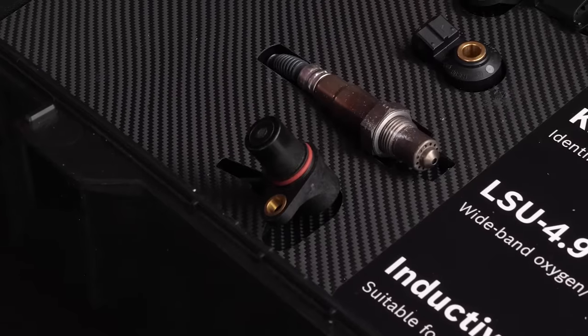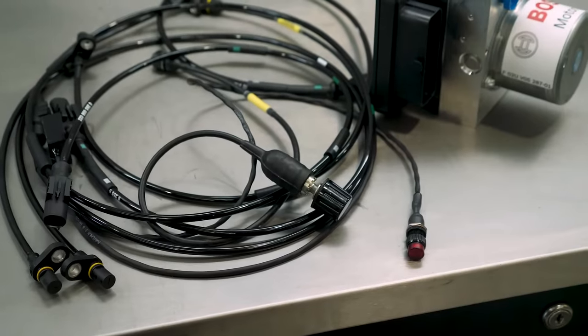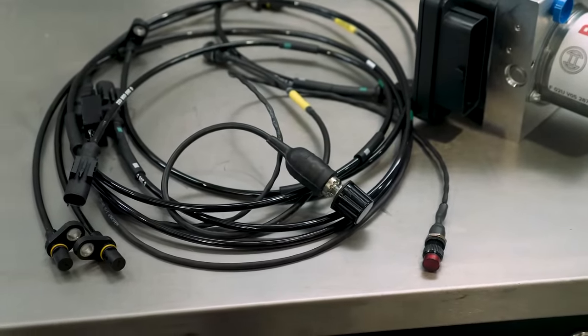If you've got a car with an existing ABS system, is there potential for compatibility with existing wheel speed sensor rings? In most cases you need to use the sensors supplied with the kit, or the specific DF11 type sensor that is required. Some very late model cars have that sensor from the factory, such as an R35 GTR, so you can use the factory sensor. But certainly on older vehicles, you must change the sensor.